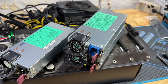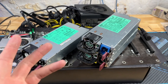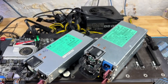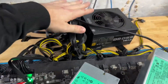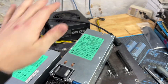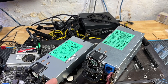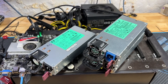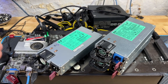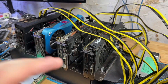I'm going to show you just how significant the power consumption difference is between these, using my only four spare GPUs to get the load as high as I can. I'll run the main board off a separate ATX power supply, completely divorced from the power meter, which runs on this plug. We'll be operating at 120 volts. I may also put it on 240 so you can see the difference there. There is a significant efficiency and power consumption difference between these two models — just make sure you're not buying the silvers. The platinums are really good.